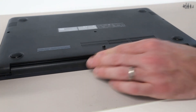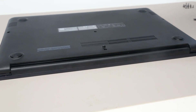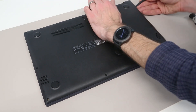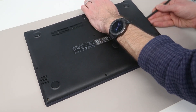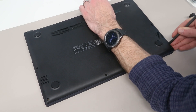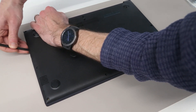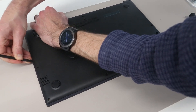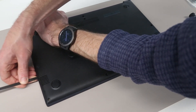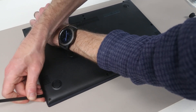With that done, we should see we have opened up a gap at the hinges here, and using that it's then much easier to get into the rest of the chassis. Having repositioned, we can then get the pry tool in down this side, and gently pulling does just help a bit here. We go pulling up the top of the chassis and working down the side, then the same on the other side — pull very gently just to help lift the base up, and then push the pry tool in just enough to disengage the clips down the side.